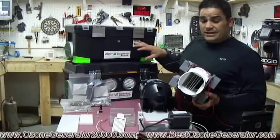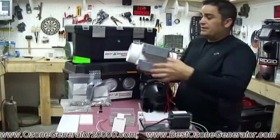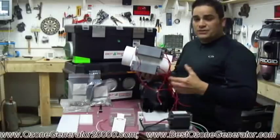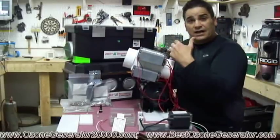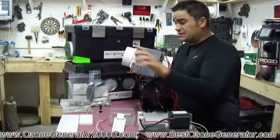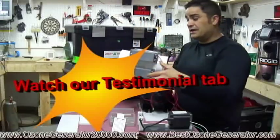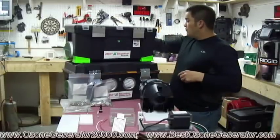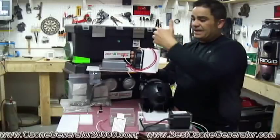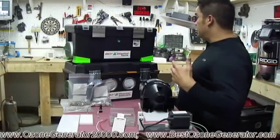This is why ozone machines break down so quickly and so many of them are so absolutely fragile. In our ozone tunnel, we have our generator cells blocked off on one end, attached to the blower, and on the other end it's shooting directly out of the box. This ozone tunnel directs air from the blower across the cells, giving you amplification and concentration of ozone generation, getting it as far away from the box as possible, and keeping all that ozone inside the chamber so it doesn't escape and oxidize the electrical components. Even in our lower-priced homeowner's models, we have a miniature version of the ozone tunnel that segregates the ozone being generated inside and allows the fan to push that gas immediately out of the box.